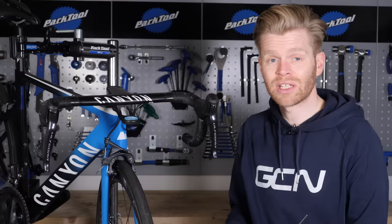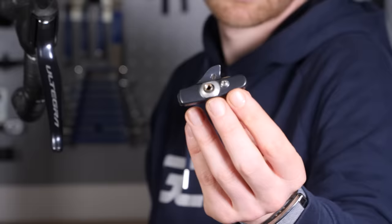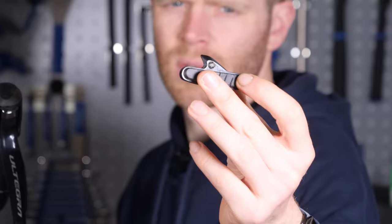When your brake pads eventually fully wear down, you'll want to sort your pads out. By upgrading them, you can also improve the performance of your brakes. To remove the pads, it's usually just an Allen bolt, and this will remove the pad and the shoe. When you remove the shoes, it allows you to inspect the pads more easily. The first thing you're looking at is the amount of wear on them — they usually have a wear line which indicates when they need replacing. Manon has managed to wear them all the way past the wear line; you can't even see it anymore, so these pads are well overdue being replaced. To replace them, you simply undo the little grub screw, which releases the pad, allowing you to slide them out and slide in a fresh set.